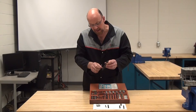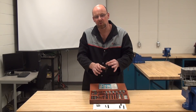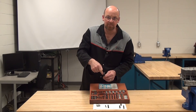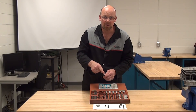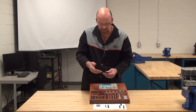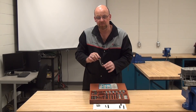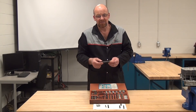Then you hammer the taper wedge in and it bites on the four protruding edges — sharp enough to bite into the broken fastener when hammered in place. A 12-point socket can be used on top, or a square female drive adapter, or a box-end wrench since it's 12-point. The technician can pick the preference of tool and the length to increase torque to pull it out. Again, never heat and quench with the fastener in place.